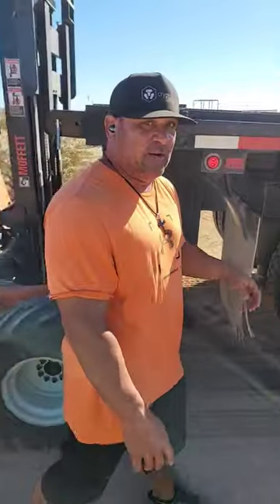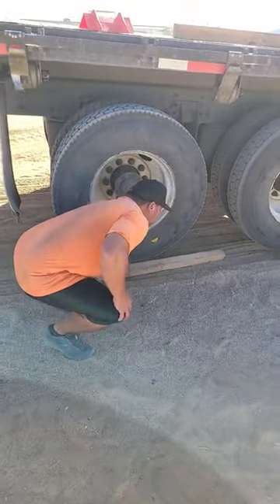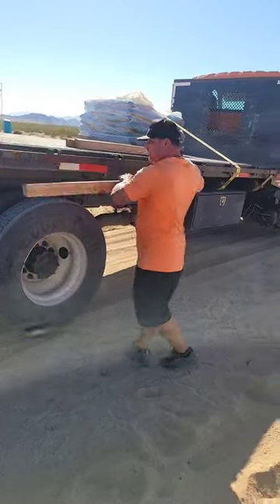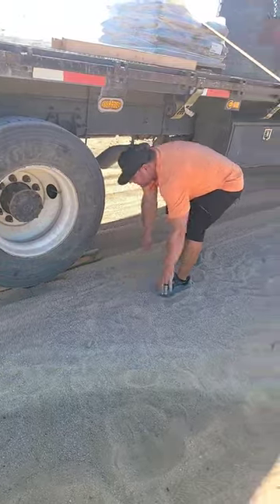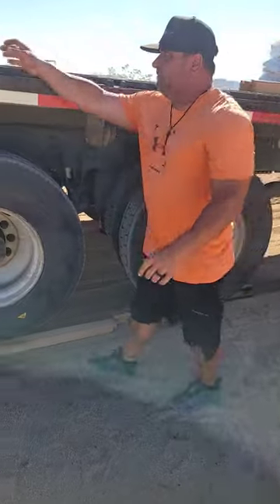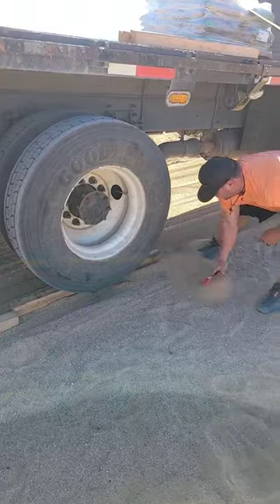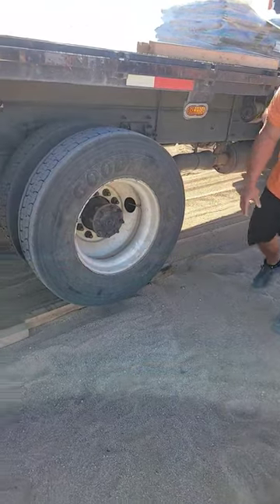Now you always want to carry some lumber with you. You're going to want to put the lumber underneath the tires. Always be careful the truck's not going to fall on you. And you want to make yourself a little path here, and you want to do this on each tire, so keep enough lumber for each tire. Also, before you put the lumber down, you want to get all the sand out of the way. You're going to use your little corner caps as your shovel.